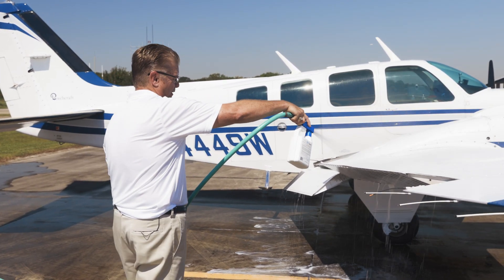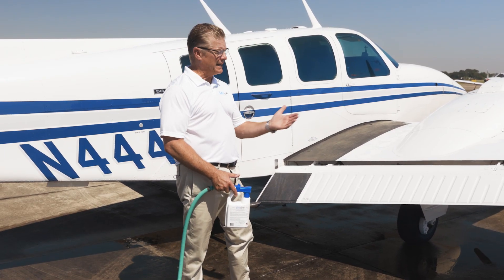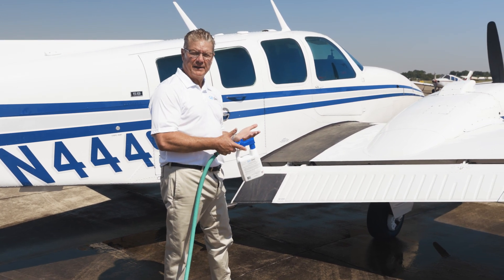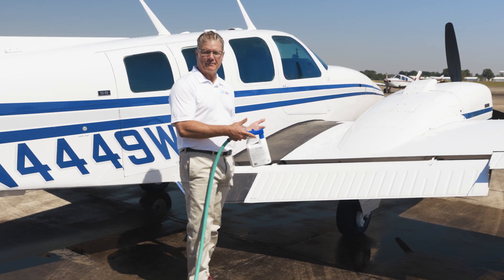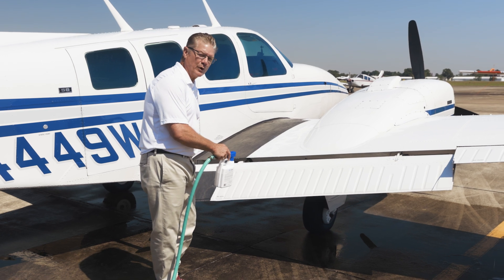Just spraying it off with water — spray on, rinse off. It's that quick. Here again, main landing gear: when you're taxiing on a salty surface or a treated runway and you bring that gear up, it'll be around the brakes and now you've got it trapped up there. This is really a spot you want to hit hard — your braking systems and the wheel wells themselves.